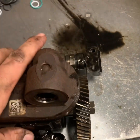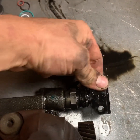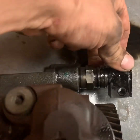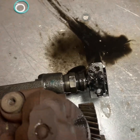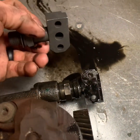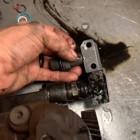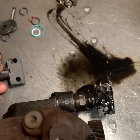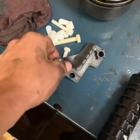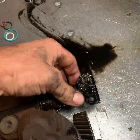We've got the high pressure oil pump out. Here's the problem — see how loose that is? It's not supposed to be like that. It's supposed to be a quick-connect fitting, and that's how they originally put these trucks together. The updated Ford kit converts it to a one-piece instead of a two-piece, and it comes with an alignment tool so the STC fitting stays lined up as it should.